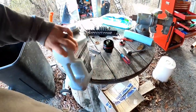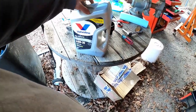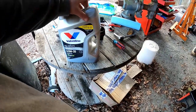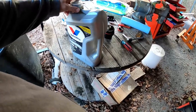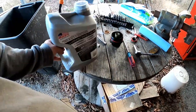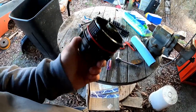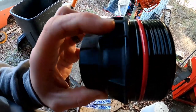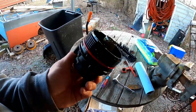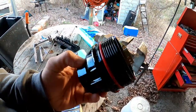In case you're wondering what I do with that other 0.2 quart of oil — I've got a jug here that I collect those little bitty amounts in. Once it gets a little bit up there, I can use that for part of the oil change and buy a smaller amount for the next one, so I'm trying not to waste that little bit of oil. If it reads low on the dipstick after I fill it up I'll put the rest in — I actually had to do that this time. I'll also be keeping the old oil filter cap because it's not failed — it just has one lobe that's starting to crack, the other three are fine. It would be a good backup just in case that metal one does somehow fail, and it will at least keep the car on the road until I can buy another replacement.